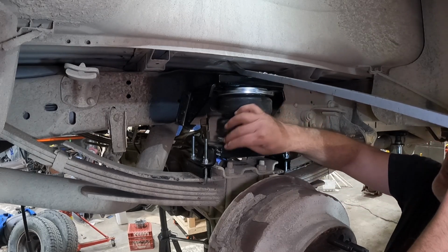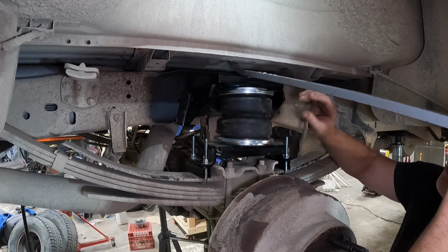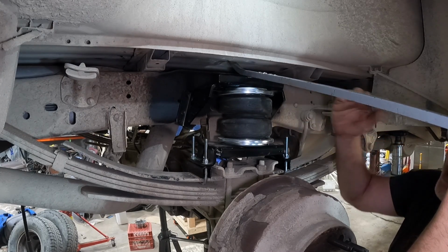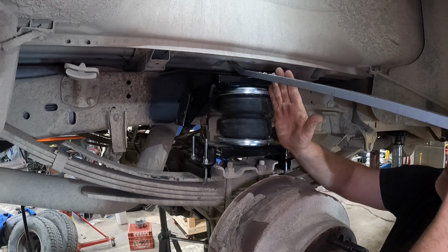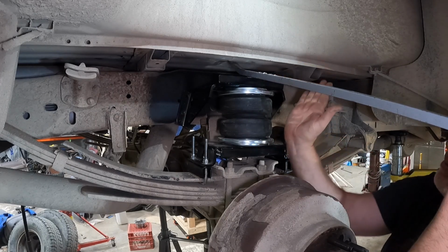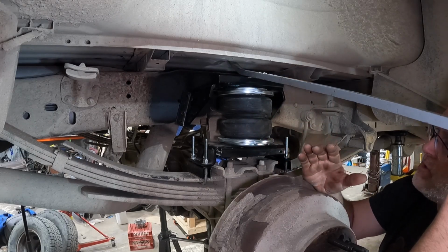So again, between 5 and 7 inches, we're gonna shoot for 6. It might be 6 1/4 on this side to make sure we hit the frame rails. And again, I'm reiterating this: this does not have to be exactly parallel. These don't have to be perfectly parallel, but they can't be radically off. And you can read that in the instruction book.